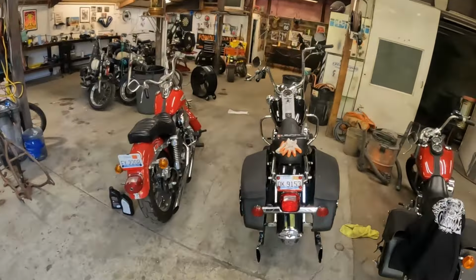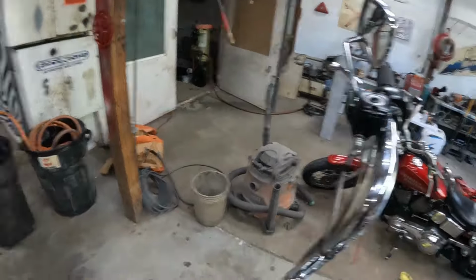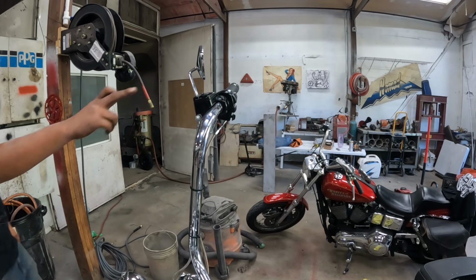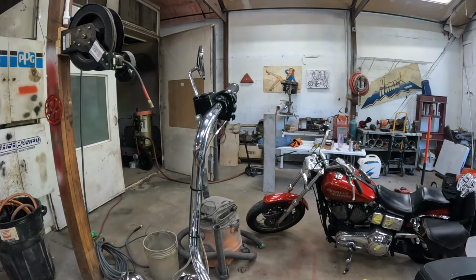and then we get to put the master cylinder cap on this guy. So, let's get after it. All we need for this is a screwdriver. Shouldn't take too much here. Little Phillips head on the cover. And I already did the arduous process. I didn't film any of it, but we did go through and pump fluid through here already. So I re-bled it, freshened up and topped off the fluid. So now it's literally just that cap.